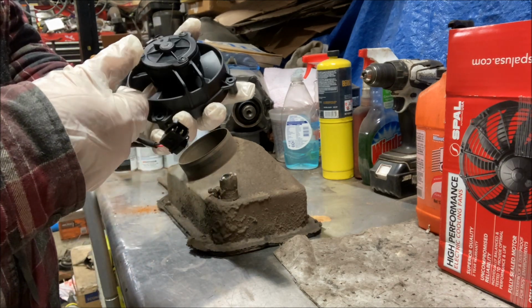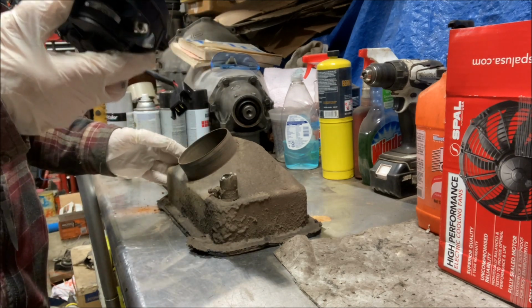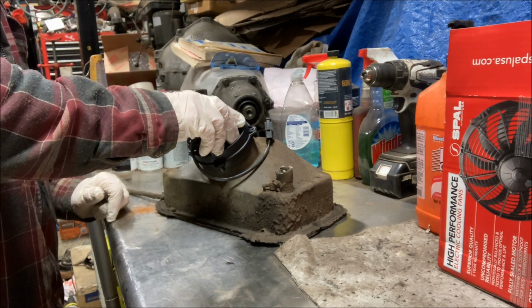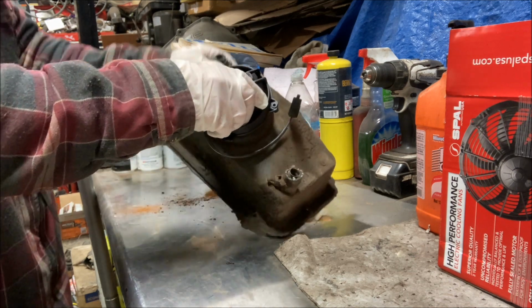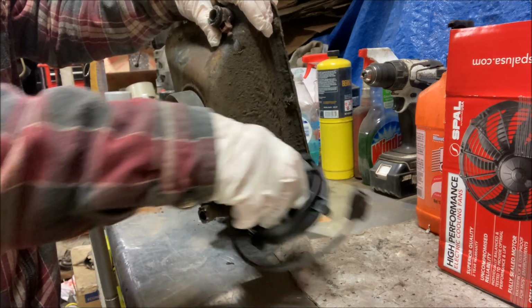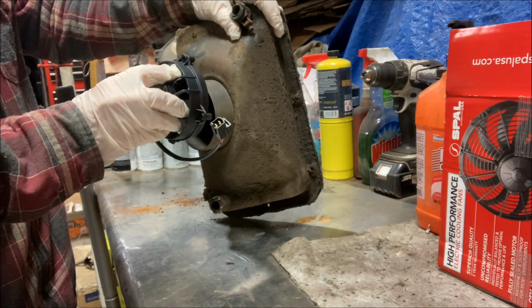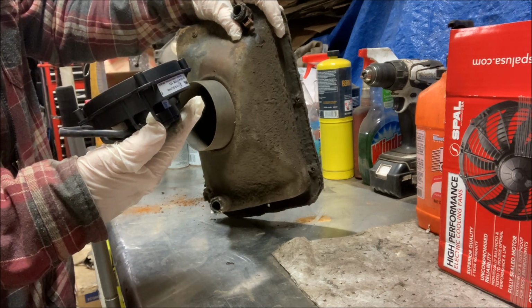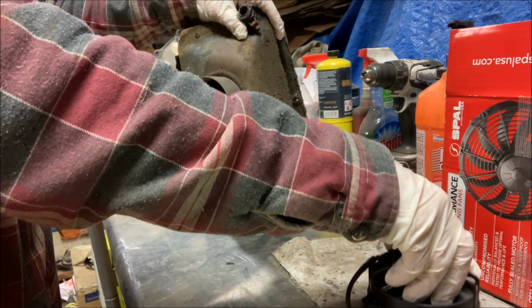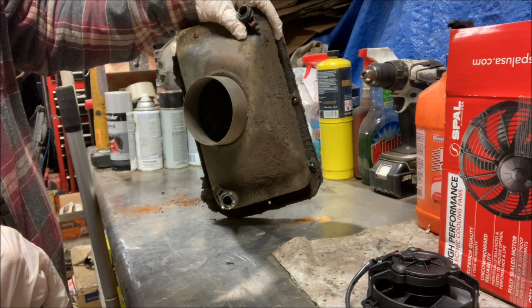This is made for, you know, like if you had a trans cooler or something and you wanted to put air across it. So it's made to put air. And the reason I wanted 4 inch is because that's the dimension of this. Now this could go out like that, but then you add to the depth. And I don't know, there's not a whole lot of room behind that fender. So what I'm gonna do is cut this section off here and make the box flat and put some studs on it. Probably don't even need studs, you could probably just use sheet metal screws or something. But I'm gonna mount this fan right to this box to put air across that heater core, and then put some power to it and see if it looks like it'll do the job.